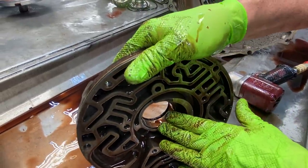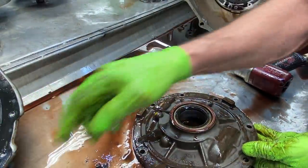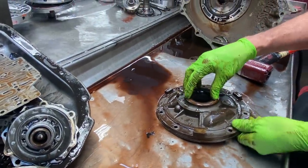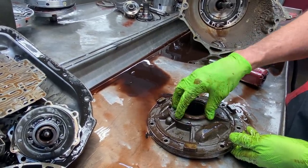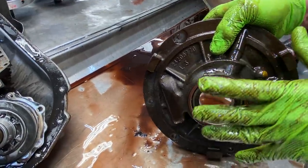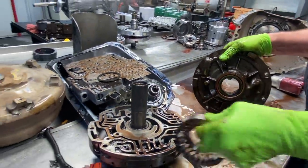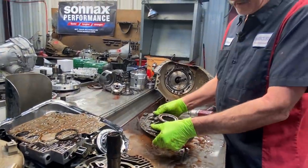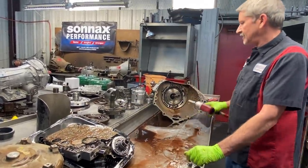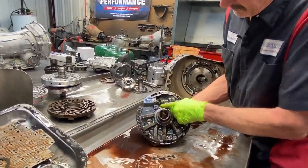When we go back with the new bushing it's going to be bad, but we're going to drill out this relief hole right through this channel really big — and through the pump. We're going to drill this hole out because it lines up with this other hole and relieves a lot of pressure off this seal, so if we get bushing wear, it's not going to blow the front seal out — it's going to drain back into the pan. We'll put new pump gears in there, and a new boost valve — your shift kit will come with a new boost valve.